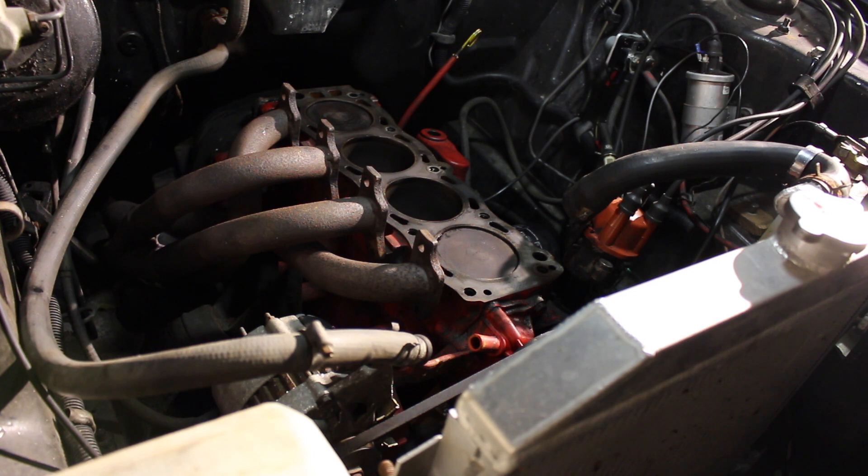In this video I'm going to be showing you how to set up the timing on a Ford Pinto engine. This one here is a 1600 or 1.6, and it's essentially the same as the 2.0 litre. Sometimes there are variations in the crankshaft pulley — you can get the cast ones or the pressed ones, and the timing marks are a little bit different.